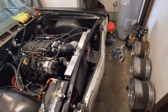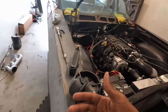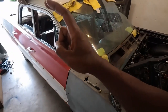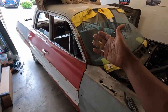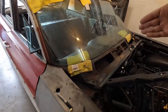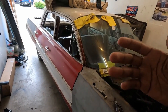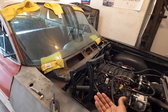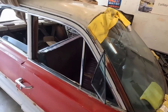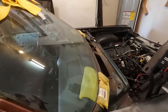The biggest headache about this build was the driveshaft — the driveshaft and the headers were the two biggest issues. Because of the 4L80E coming from a Power Glide, I pretty much had to get a custom driveshaft. I have the stock two-piece driveshaft — didn't change the rear end or the yokes, though I got them replaced. I had the actual slip yoke for the 4L80E put onto the driveshaft. The issue was I could not get the correct length at the beginning.